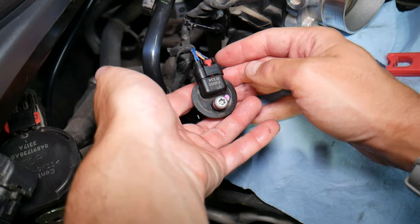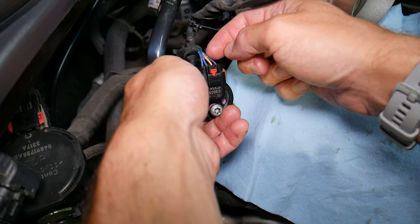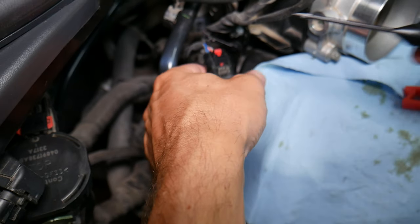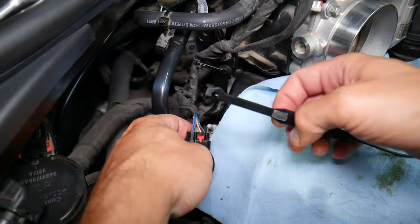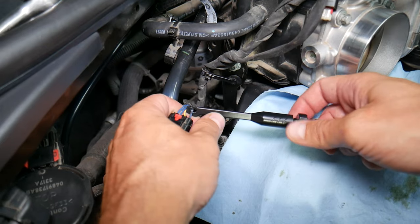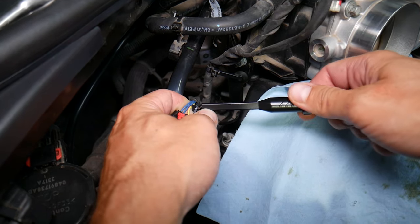In some cases, if you have problems with the camshaft sensor and you still don't get signal even though yours is good, it could be a wire that's pulled out of the connectors, a broken wire, a powertrain fuse, or powertrain relay. We're going to get those special probes that are not expensive at all — I'll put the link in the description below. What you can do is come around the wire, and it's going to poke a hole in the wire without cutting it, so it can go through the wire and we can get a signal.